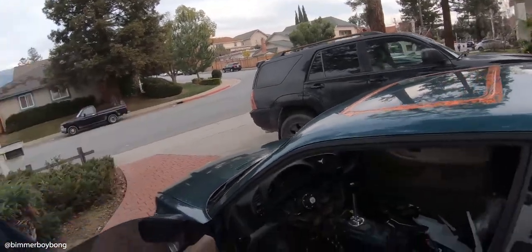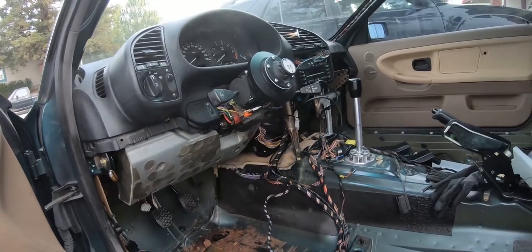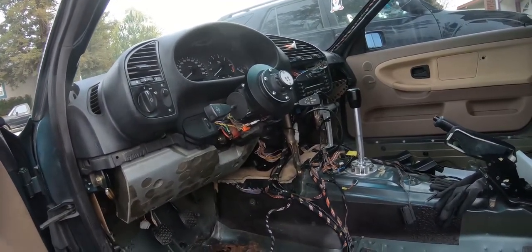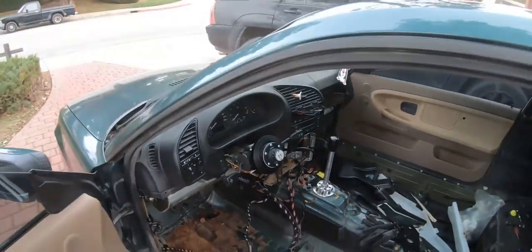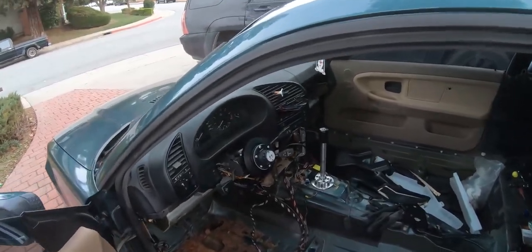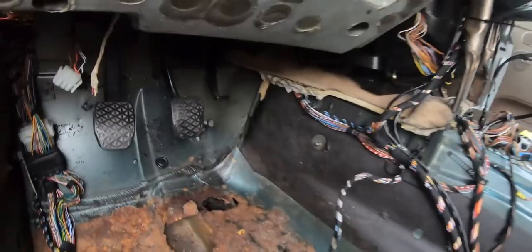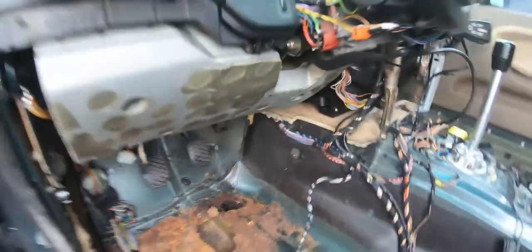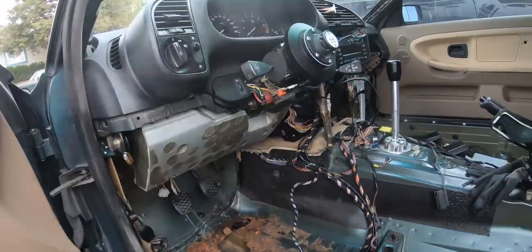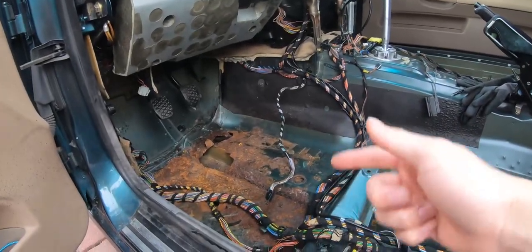So, update: the heater box — got the O-rings back in, the foam seal put in, so everything's done with that. Got the heater box back in the car, turned it on, ran it for about 10 minutes, and then turned on the heater to make sure the coolant wouldn't leak through — and it wasn't leaking. Connected up the AC lines, and then put the dash and everything back in. So now I can go on to repairing the rust.